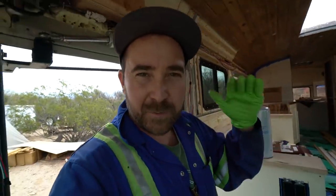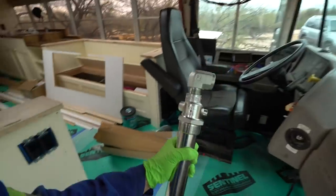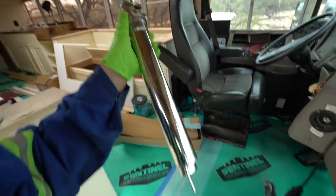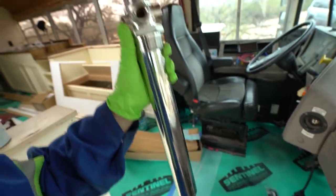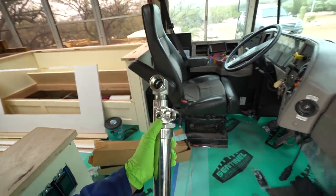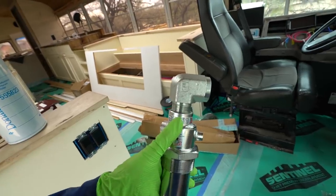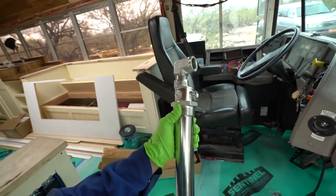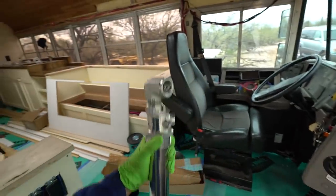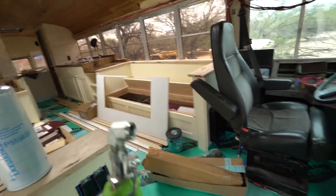However, the total distance from the top of the tank to the metal floor is about five inches. This unit here is a Hot Fox — I bought it off eBay trying to get a good deal. It has a separate fuel sender for something like a Webasto, basically a secondary fuel source. The primary fuel source comes out of the top like a submarine periscope. This is too tall — I'm going to have to get a different unit. I can't use this; it's going to be too tall unless I lift up part of the metal floor.